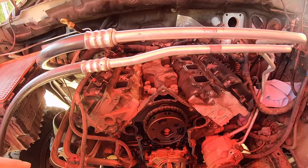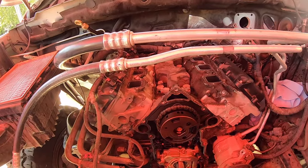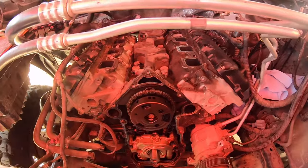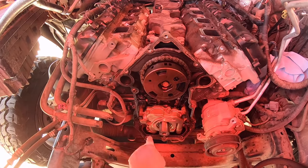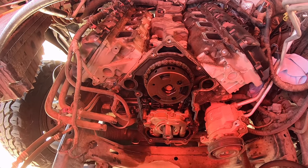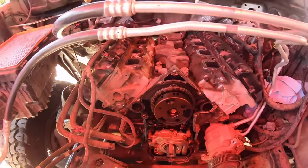Welcome back. In the last video you saw us take off the front timing cover and expose the innards. It just has the older timing guide on it, so as we commented, we'll get a new timing setup to include tensioner, guide, chain, and of course we'll upgrade this to a Hellcat oil pump.